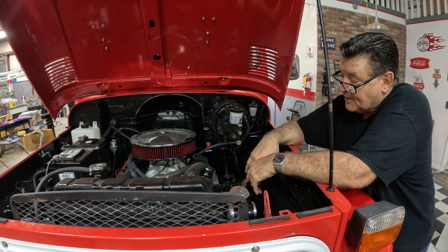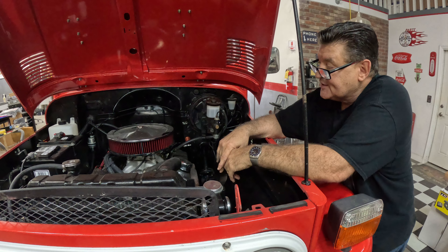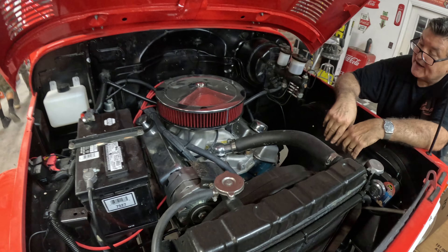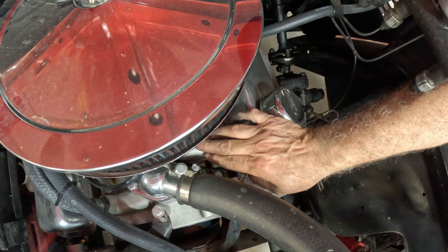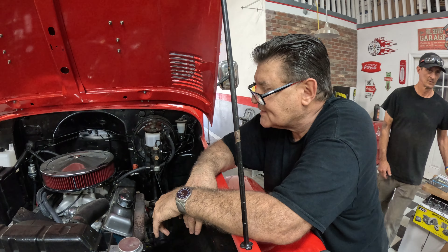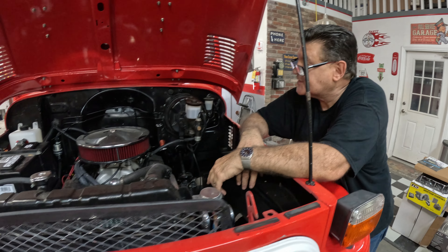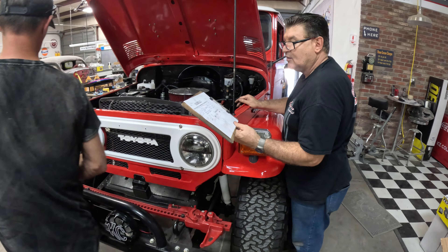What concerns me is it's a used, bone-stock engine with only 95 PSI compression throughout the cylinders. It's pretty consistent, but these things should be pushing about 125 to 150 stock. They've got a high-rise manifold on there and somebody stuck a JEGS label — actually an aluminum plate glued on with a JEGS decal. Chances are that's not JEGS; I don't see Edelbrock anywhere, so most likely it's a Taiwan repop. Professional Products makes a lot of stuff like that. This truck just came to us yesterday — we didn't build it, but it runs poorly and the brakes are bad too.